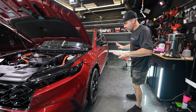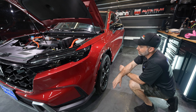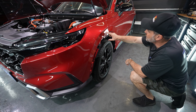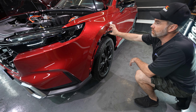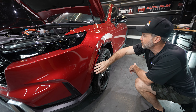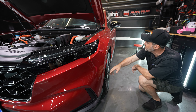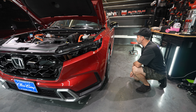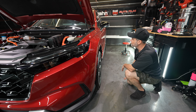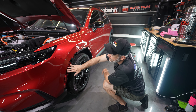This has the HPD package — I don't even know what that stands for, I'm sure somebody can tell me in the comments — but it has this giant piece of plastic. You can kind of see the line where the plastic was sitting along the edge here of the rubber gasket. So we're gonna tuck our film all the way underneath and give us a much cleaner install, both on the bumper and the fenders by removing this. It was a few screws, some pop tabs, some double-sided tape. I couldn't find anything on the internet, so I had to figure out how to do it myself, but it wasn't that difficult. We got that removed, and that's gonna give us a cleaner install.